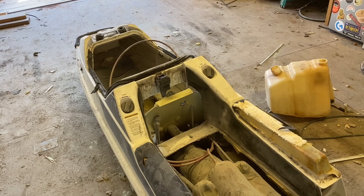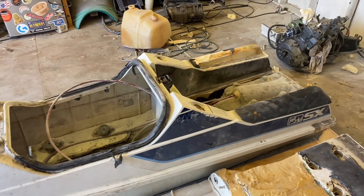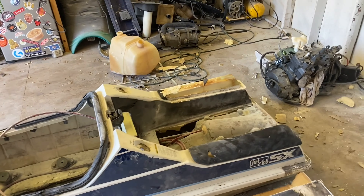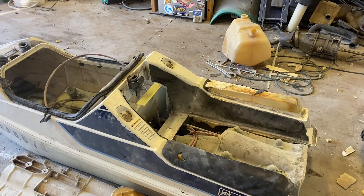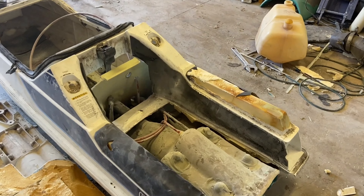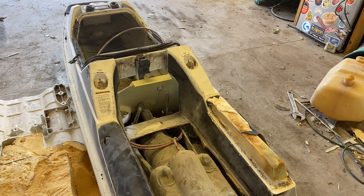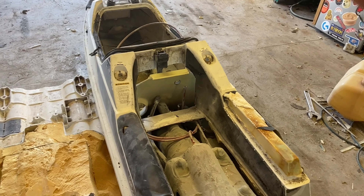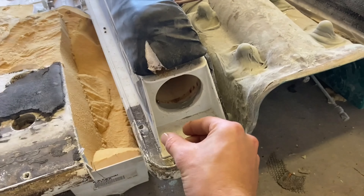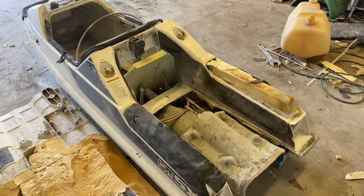Just like that, we're back here the next day — no panel bond in hand unfortunately, that's not going to come in until Friday. But we do have quite a bit more to do before we even need to use that stuff. First off, we need to chop these rails and get some more room for some footholds. I already have this side off — all the padding — just need to take off that old plastic, and then same for the other side. I think I'm going to chop it probably about half an inch to an inch, and I think that will give us plenty of room. Let's start chopping these rails.